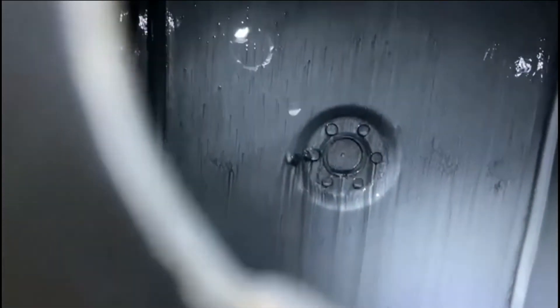Straight after that treatment it's now a million times cleaner. I've got a feeling these tanks are galvanized - I think they are - so I think it'd be good enough like this. But we'll run the sealer in just to stop any rust. I'll see if I can stick the light in here so you can see. You can see the corners were really bad but now they're pretty clean - they look like just stains but the edges are all clear, it doesn't leak.